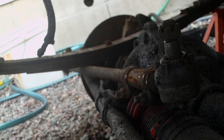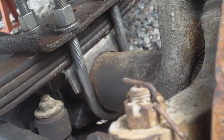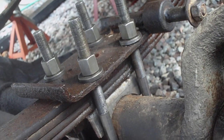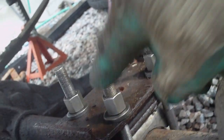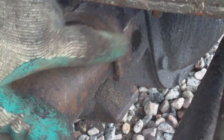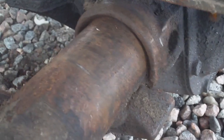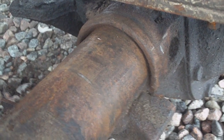What I've done here is loosened off the nut that holds my pitman arm on, took off the steering, and disconnected it. Now I'm putting in my spring perches and my new u-bolts. Got a lot of excess here to cut off still, no big deal — got them a little bigger just in case. Now guys, be sure when you're doing a lift like this, you take into account that one of your u-bolts is going to go right around this, which requires it to be bigger. So make sure when you take off your old u-bolts, you bring them in, get them sized accordingly, and have them made.